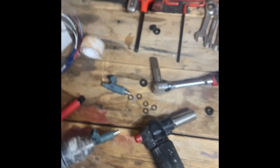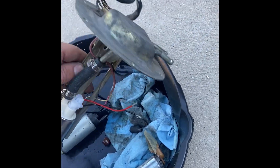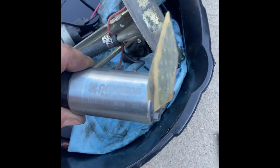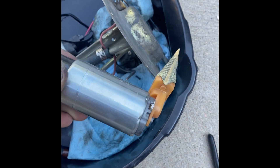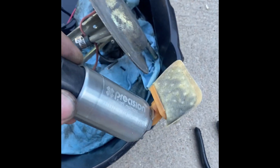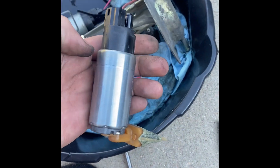Once you shave it down and pop that cap off, this is effectively an 880 or 900cc injector now. On the JZ R32 I'm going E85 — well, I've gone E85. This is the pump that came out of it. I ran the number and it's like an AutoZone or Advanced Auto something-or-other out of a Ford truck.